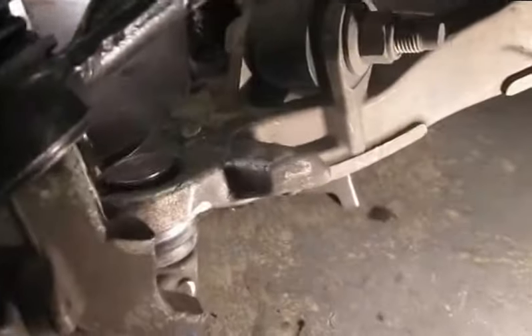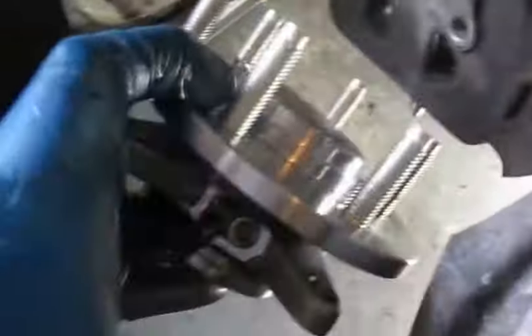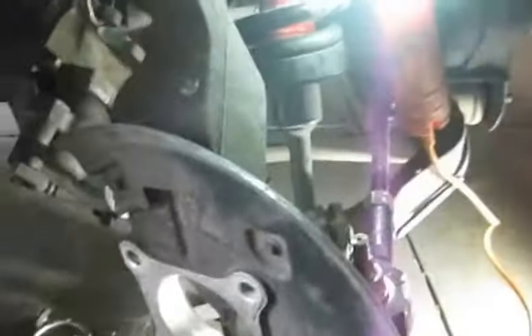Alright, so we got the knuckle back on — three bolts: this one here, this one here, and then the ball joint. These two upper bolts are 111 foot-pounds of torque and the bottom ball joint bolt is 148 foot-pounds. So you need to know those specs. Now I'm getting ready to put the new hub on and hook that all up.